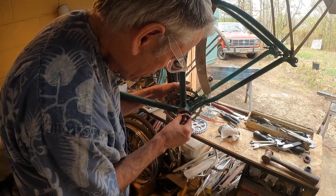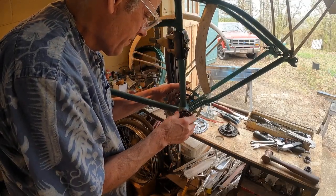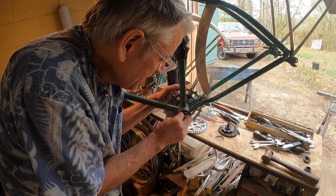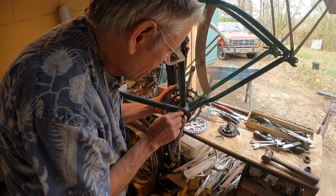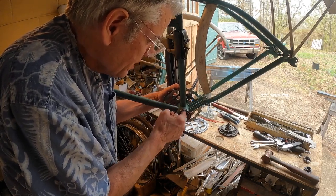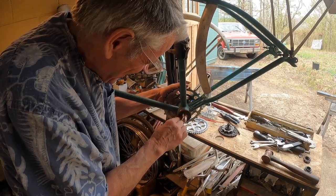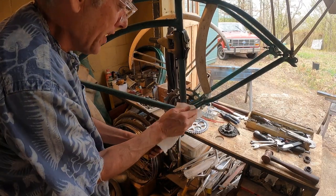Sweet — make sure all the grease comes out. Now, can you see why I dry fitted it at first? Because I wasn't sure about what was happening. Wouldn't it be a bummer if we put it all together with grease and it was wrong, like five times? So if you have the opportunity and you don't know what's really going on — like this bike was basically a basket case with the wrong parts — try to dry fit things first if you can. That way when you're taking it apart for what is it, five times now, it won't be so messy. Because we like to keep things happy and clean here.